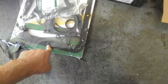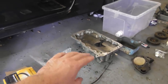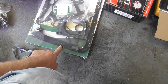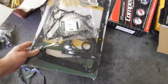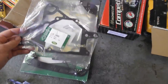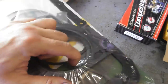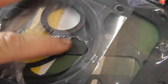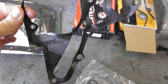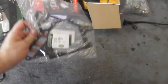The heads of the bolts are actually quite generous. Two things that would ordinarily worry me: it's cast alloy, so it's not going to deflect or bend like a shitty steel pressed sump; and there's so much cushioning and no sealer involved, so it's not going to get squished out by distortion of the flanges. I've pretty much reassured myself that's just going to go together nicely. I bought a genuine Land Rover oil pump gasket, because the one that came in the kit is paper — well, embossed semi-compressible material — but the original is actually tin, designed to compress. So rather than use that weird papery one, I've bought a genuine Land Rover one.